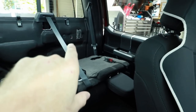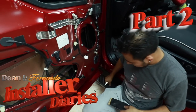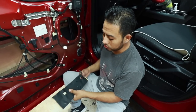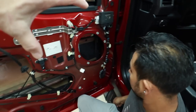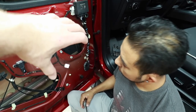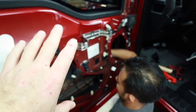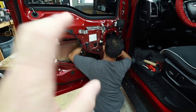For our install we'll be going in this area here. Fernando is doing a basic sound treatment on this door — the customer has supplied the Second Skin sound treatment. What we're going to be doing is what we call a basic plus, concentrating all our energy on this aspect of the door panel. It's not a full baked potato. With this level of speaker, we don't need to go super crazy. Just hit the points where it might rattle, put the vapor barrier back on, and everything will be good.